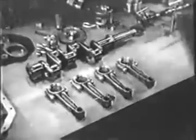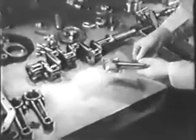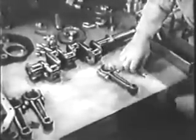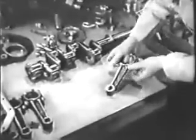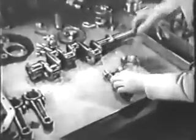The first step is to assemble the connecting rods to the crankshaft. Check the tag to see where the rod goes, and remove the tag. Now separate the two parts of the rod, and oil the bearing surfaces thoroughly, both on the crankshaft and the rod itself.